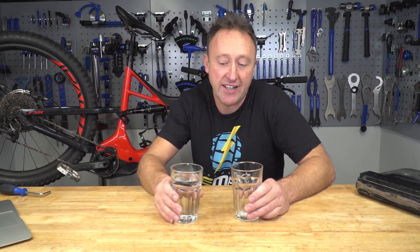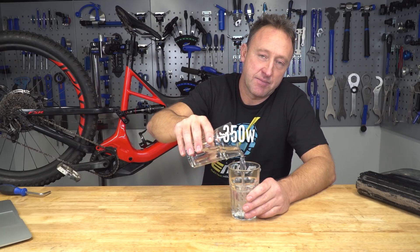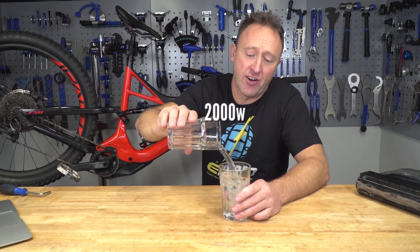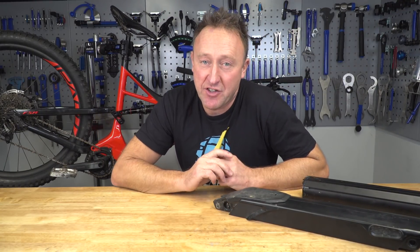It's not as simple as that though. Think about someone like Chris Froome, who dishes out maybe 350 watts on a one-hour ride — he's going to be trickling that energy. However, someone like Andre Greipel, an Olympic sprinter, he's going to be doing maybe 2,000 watts over 30 seconds — chucking it all in the tank. So in basic terms, the more watt hours you have in your battery, the greater the range you're going to have in your e-bike.